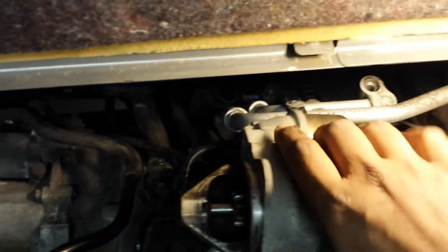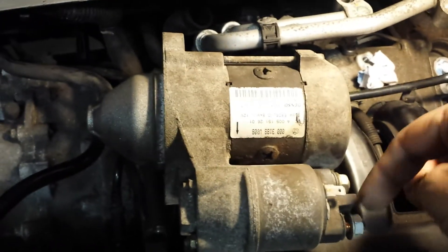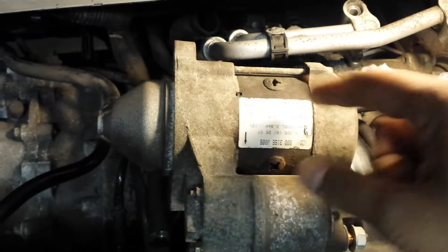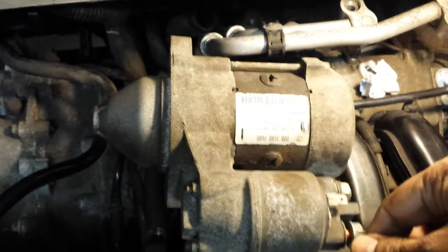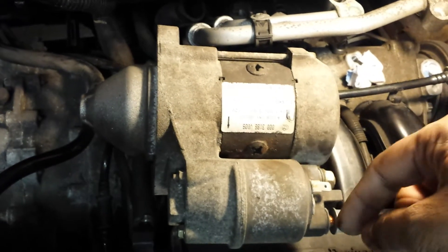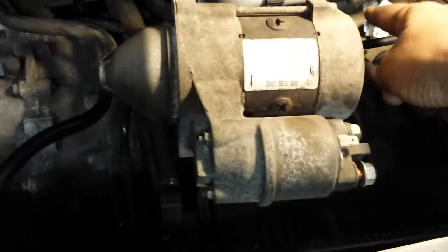As soon as I lifted those two pipes I could actually disconnect the motor at the back. The motor sits something like this, just behind the pipes. The difficulty was actually disconnecting this bolt so you can release the main battery lead, and this is the connector for the solenoid which charges the solenoid and makes the connection to spin the starter motor. Disconnecting this was the challenge because there wasn't enough space. Because I removed the air conditioning pipe it made the whole job very very easy — as soon as I pushed that out of the way along with the other two disconnected pipes.